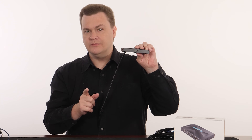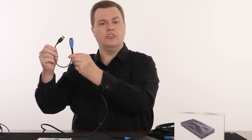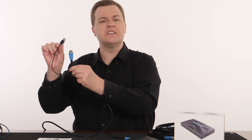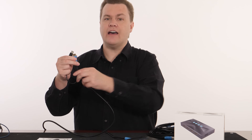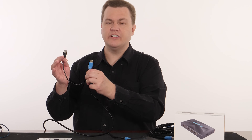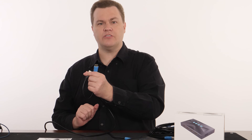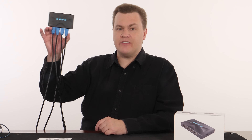On the other end of the cable, you have a standard HDMI plug and a breakout USB plug — the data is sent along the wire. The HDMI plug goes into your video card as you normally would; the USB plug goes into any available USB port on the computer — 2.0 or 3.0, it doesn't matter; it's a 2.0 connector primarily providing low-speed data and power. This is how the KVM switch gets power, and it's also sending the keyboard, mouse, and whatever you plug into the third connector along to the computer.